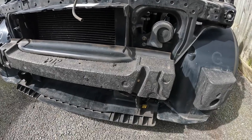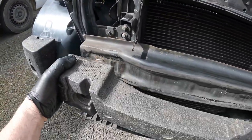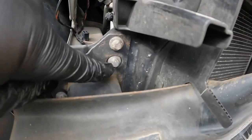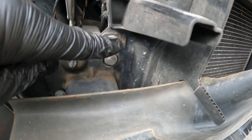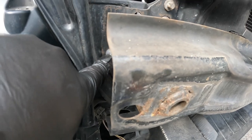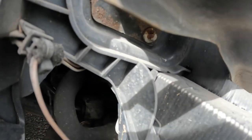Removing this polystyrene piece makes it a little bit easier to access the bolts — it just unclips like that. This bolt doesn't have to be removed as it's not holding it on. You've got three each side, one of which is very hard to see just under there.